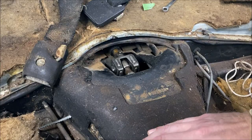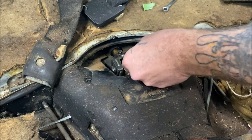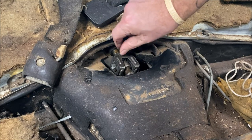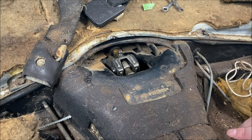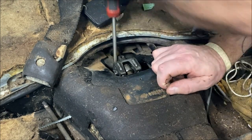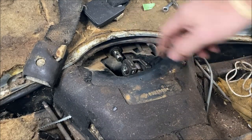First we go inside the car, under the back seat. You're going to loosen your shifting coupler and remove it — it's hooked to the nose cone shaft of the transmission. Use an eight millimeter. Now a lot of people try to pull on these; what you can do is grab your gear shift and pull it back towards second gear to help it come almost off and make it a little easier.